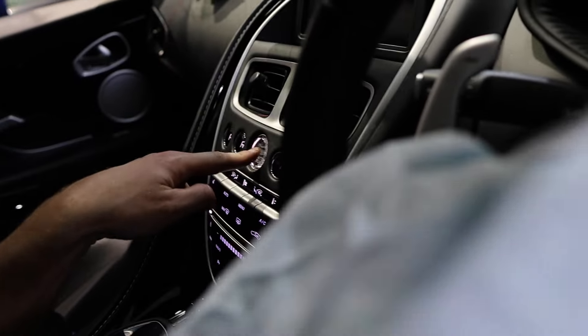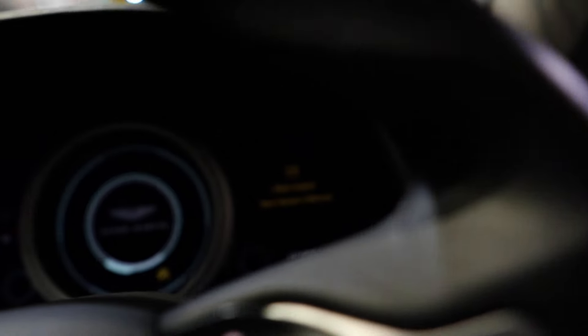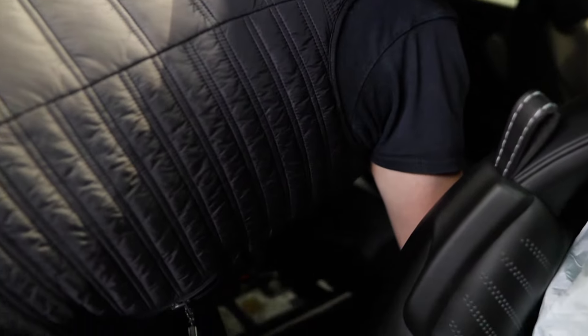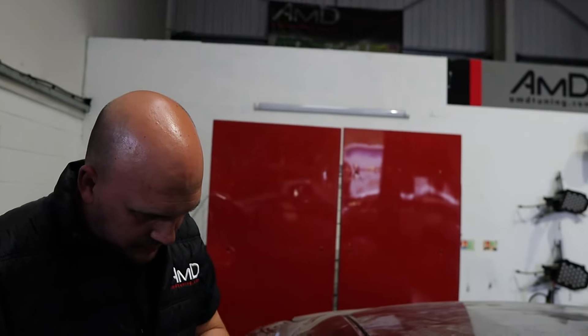Is your foot on the brake? It's just... starting... Right, pyrofuse. That makes sense - that does actually make sense. Pyrofuse is basically a safety function: when the car's in a crash, it cuts the pyrofuse and cuts all power going to the engine. So we found the pyrofuse, we bypassed it, and let's pray it's going to start.